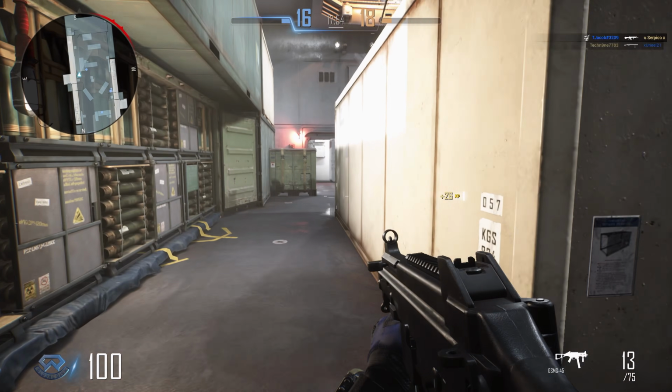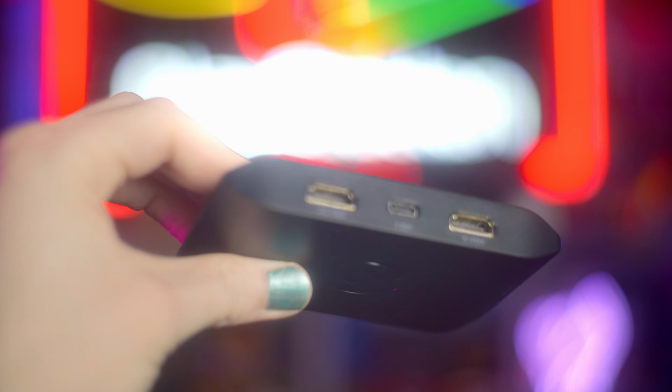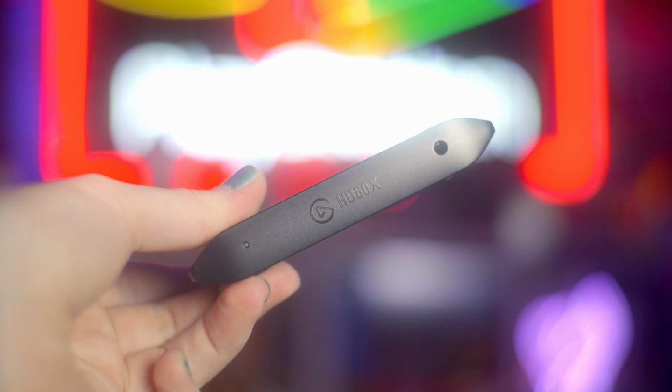The front of the capture card features a 3.5mm line-in audio jack. This is not a headset combo jack. It can't be used for hearing sound or a headset mic, at least not on its own, but you can run the final mix from your setup, a mixer interface like GoXLR, or if you use a mix amp like the Astro Mix Amp or another audio extractor, use the line out from that to pipe into your capture, and then you select analog audio in 4K Capture Utility.